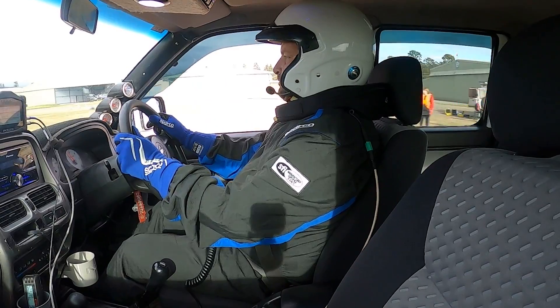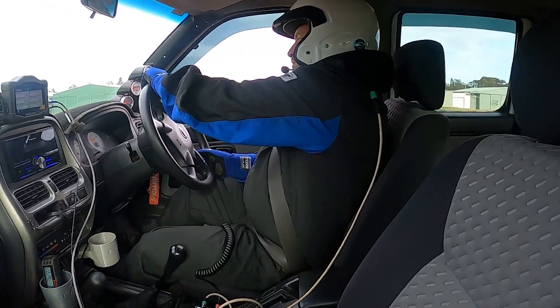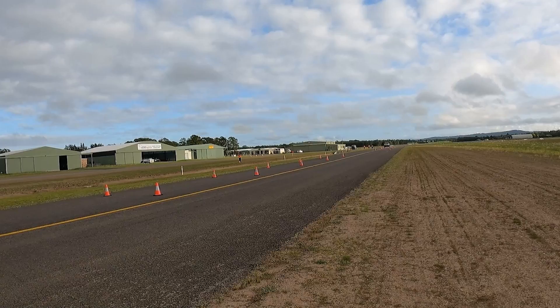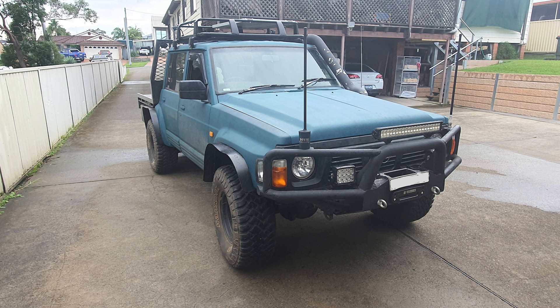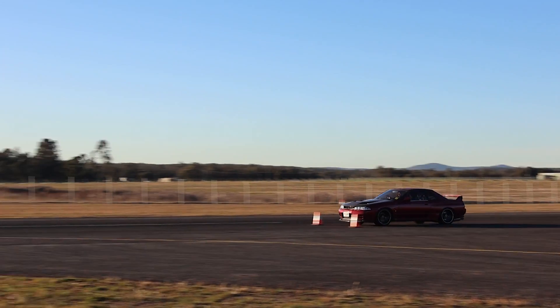These are the requirements for passenger vehicles. For goods carrying vehicles — utes, vans, and some four-wheel drives — it is as per Test Mass 1, plus sufficient weight evenly distributed over the goods carrying area, up to the vehicle's GVM. Sometimes seating or body modifications can change the vehicle's ADR category, and if this happens, the resulting category test requirements are followed. The first attempt needs to be at or under 80 km/h, and with some high-lifted vehicles I will start at 60 km/h.